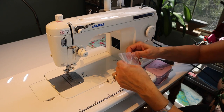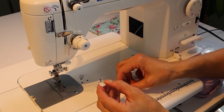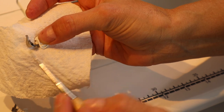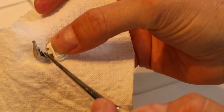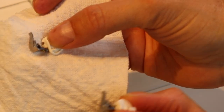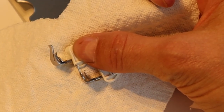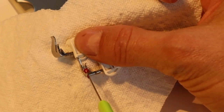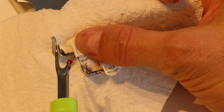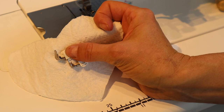Now, what I want to do is look closely at this new part and see why mine didn't work. There are two pieces of metal, and then in the middle there's a very fine filament. And if that gets misaligned, your needle threader is not going to work. It looks like the one I had on there is bent too much towards the middle. Theoretically, you can press that little filament back into position, so I'm going to try to do that off camera and see if I can shift it more towards the right-hand side to emulate the new one. In the meantime, I have an extra one on the machine.